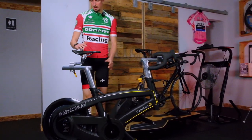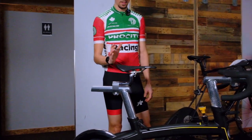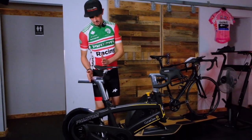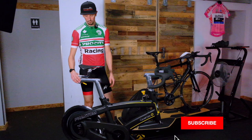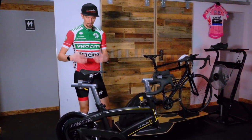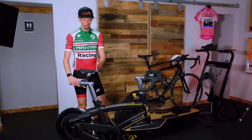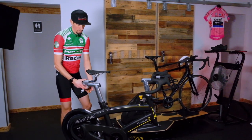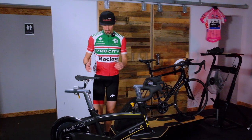There's another determining factor with saddle height and that's our fore-aft — how forward and back our seat is. If you're too far forward you might find you're always sitting on the back of the seat or falling off it. Your effective saddle height is actually shorter when your saddle is further forward, so if you're changing the fore-aft you should also be adjusting the up and down of your seat height to accommodate for that. If you go further back there's a greater distance, so you'll need to lower the seat a little bit. In theory you want to be sitting on your sit bones on the back of the saddle, moving the saddle so you're not on the nose and not falling off the back. Once you've got these numbers dialed you don't have to do this again.